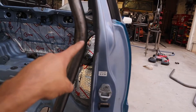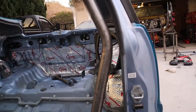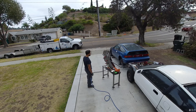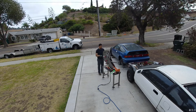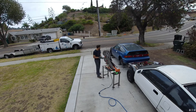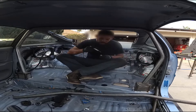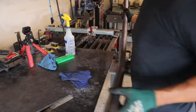Next is a harness bar. It's going to go from here to there — probably a 45-degree bend, have it shoot out, come over, and shoot back in. That's going to add some depth to the cage. Here I marked where I need to cut it, right there and right there. Now I'm going to use a tube notcher to make my copings.